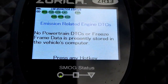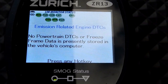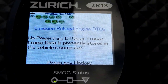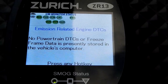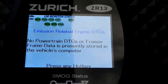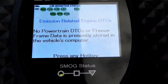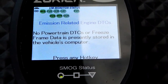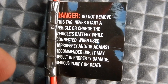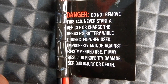So now what I'm going to do is shut the car off, pull the key, and plug in my saver from NOCO, and then we'll disconnect the battery. Then we'll leave it off for about 30 seconds, reconnect the battery, and see if it saved everything. It does have a warning clearly tagged on the NOCO saver, and it's also on the box.